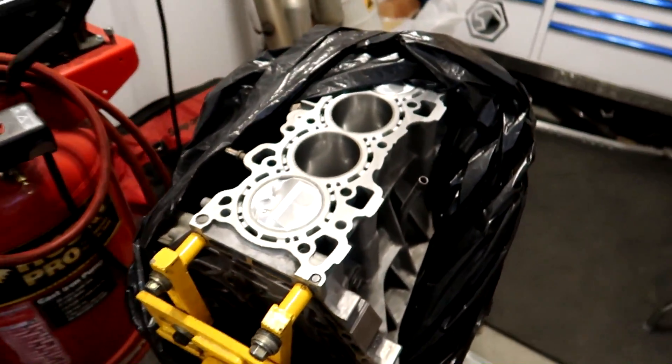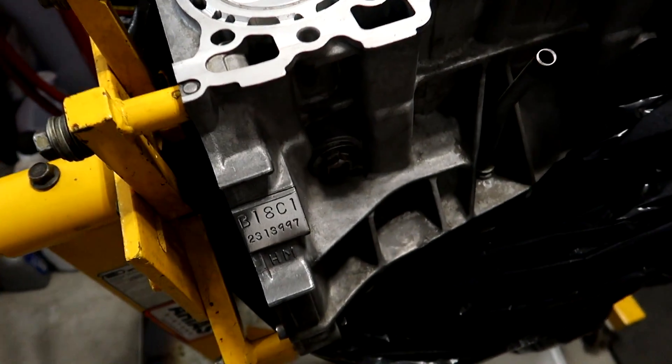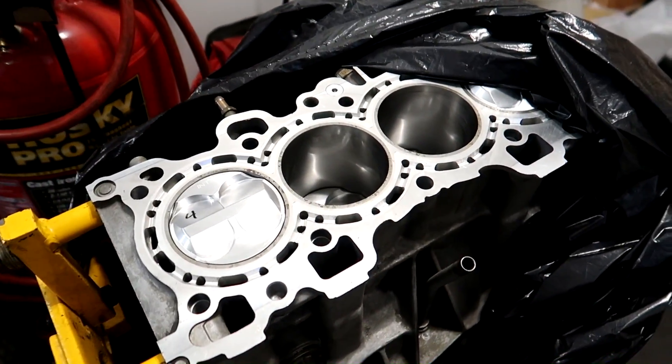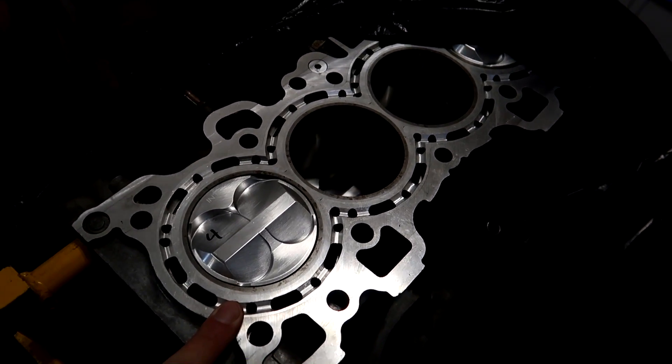What's going on guys, Dan here. Today I'm going to make a video about working on this cylinder head for the engine for the Civic. My Civic is right over there and I'm going to be building a GSR engine for that — it's going to be all-wheel drive when I'm done. This is the engine that's going to end up in there. This is a GSR block, the B18C1, and it has a CNC block guard which you can see here — this was done by DA Fab in Denver, really great guys down there.